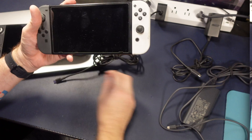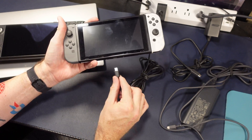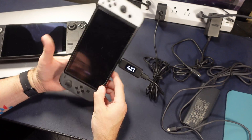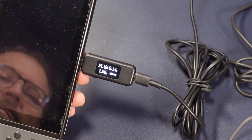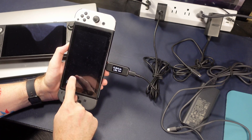So can you plug in your Steam Deck power brick into your Switch? The Switch is also a PD-compatible device. When you plug this in, there's a communication between the device and the power source — it says it needs 25 watts at a certain amperage. The device, being PD-compliant, says yes and delivers exactly what's asked for. No more and no less, provided it can actually provide the amount of power required.